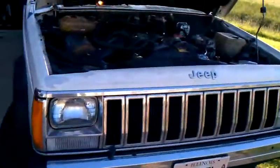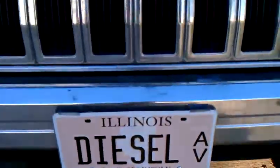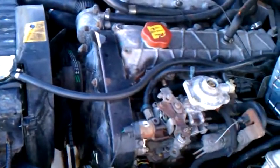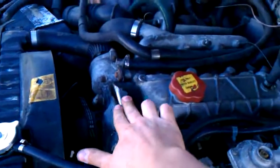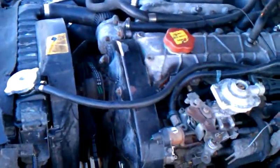We're up for the next installment of the Comanche Club diesel Comanche. I'm going to be taking it in to get the injection pump timed by a professional next week. In order to make the journey, I actually put the timing cover back on — it had a rub mark from where the hood insulation was hitting the timing belt cover, so obviously I don't want to run it down the road with the timing belt eating away at the hood insulation.